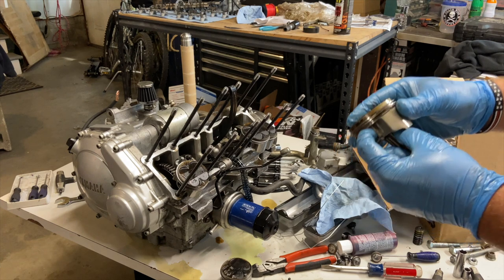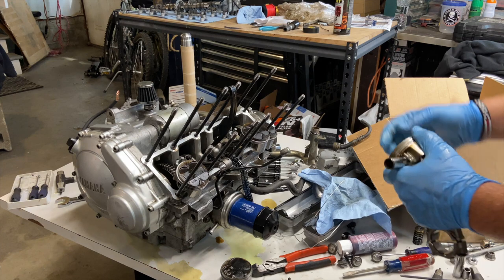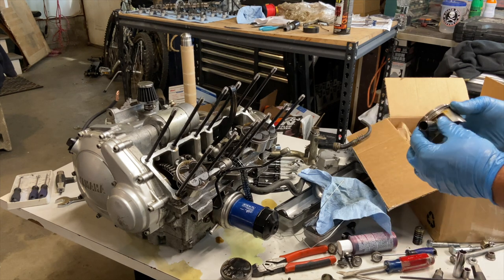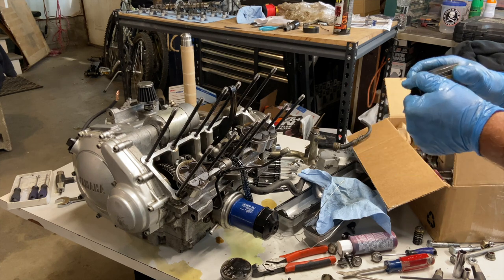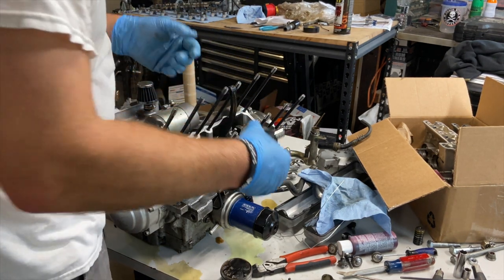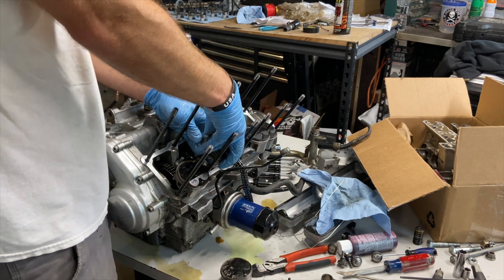Slide the wrist pin out. The only thing you really need to match up is the wrist pin. And the wrist pin is pretty universal and doesn't have a lot of friction on it. That connecting rod does. There's a lot bigger of a moving surface on it. Now we'll check it when we get it on here, but wrist pins aren't machined to the same standards as a connecting rod.